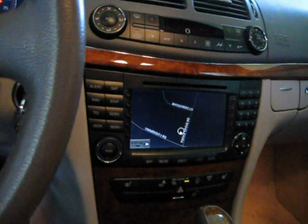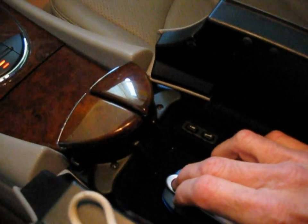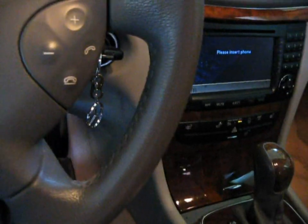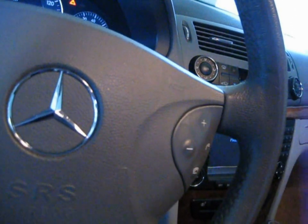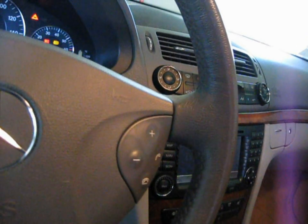We're going to test out the phone system now. Hit telephone, then hold down the pairing button for three seconds until the blue lights start blinking. Go to Bluetooth on your phone — it requires a PIN for pairing, and it is 62872, which is true for all of them. We are connected.